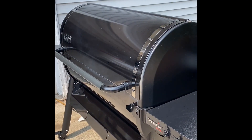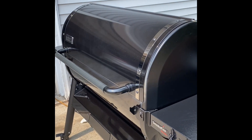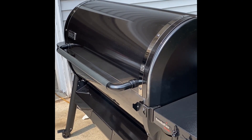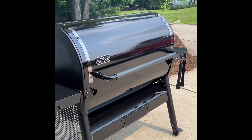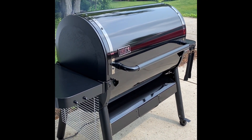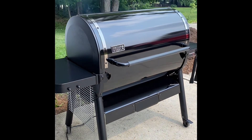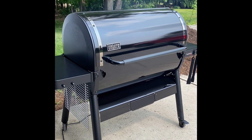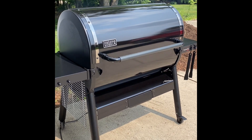With the burn-in now complete, I dropped it down to smoke boost mode to season the inside of the grill a little more. A couple of things I noticed: first, there's a lot of smoke escaping from the front of this grill — much more so than during my Pit Boss days — and I'm curious how that's going to play out in wintertime holding heat. Also, this grill has a variable speed fan controlled by the electronics. With the Pit Boss, the fan was on full blast constantly, but this fan picks up and drops down depending on what the grill needs to do.